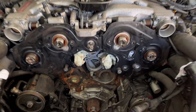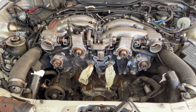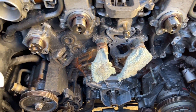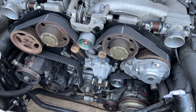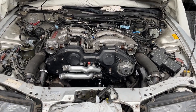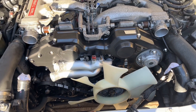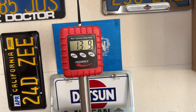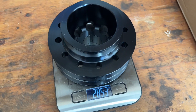So we went through and I cleaned up the entire front of the engine, replaced the cam seals, the crankshaft seals, put on a new crank sprocket, tensioner, new water pump, new belt of course, and then we installed the AMS overdrive and underdrive pulleys which are aluminum. Just take a look at this — it came out great. The stock crankshaft pulley is 13 pounds 9 ounces and the new AMS crankshaft pulley is 28 ounces.